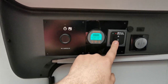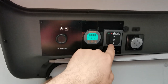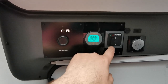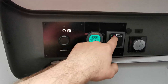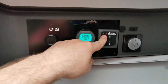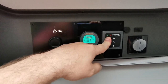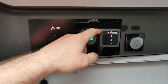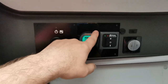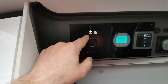Up here you've also got the hot water heater controls - two switches. The bottom one turns the gas on and heats up the hot water with no temperature control. The top position is the frost symbol - it puts the hot water into frost mode so if it gets too cold outside it kicks in to stop it freezing. On some newer vans there's a frost dump valve, which I'll show later. Luckily we haven't got it - a lot of people have had problems with that.